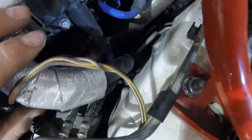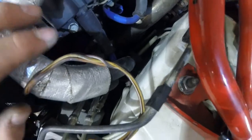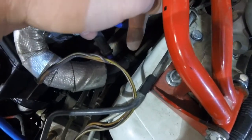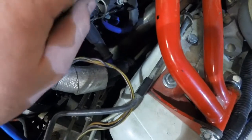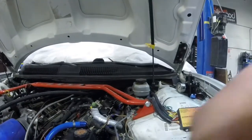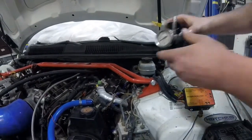As I mentioned in the fuel system videos, I'm using the stock feed line for the return. So the return I'll be able to do with a push-lock fitting that's got a dash-6 fitting on it, and just make a little couple-inch hose to drop straight from the bottom down to there. That'll be real simple on that part.